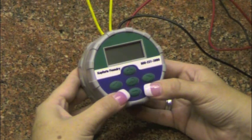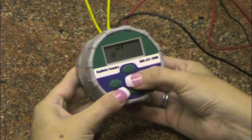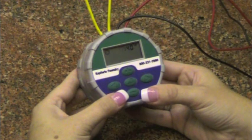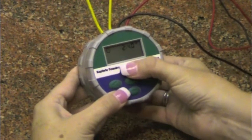To set the current date and time, press the main menu button to wake up the controller. Then press the main menu button until the current time date icon is displayed. The current hours will be flashing. Press the plus or minus button to change the setting to the desired hour.